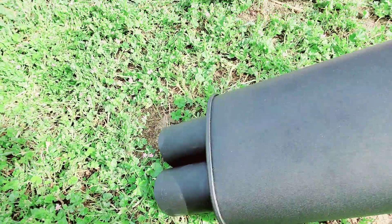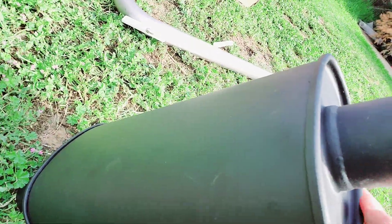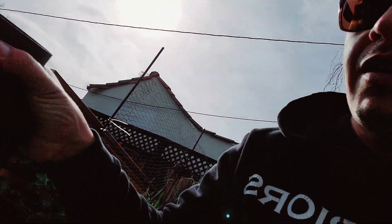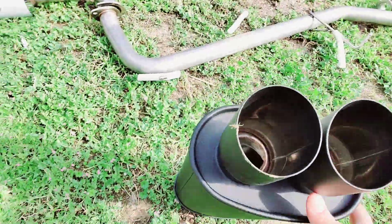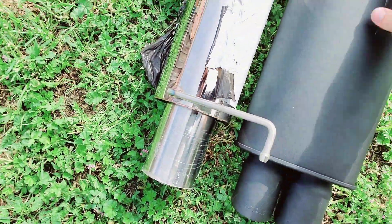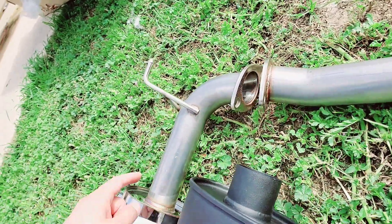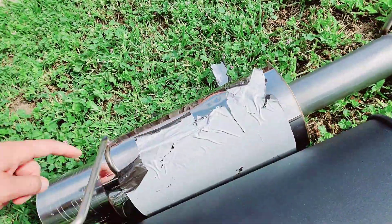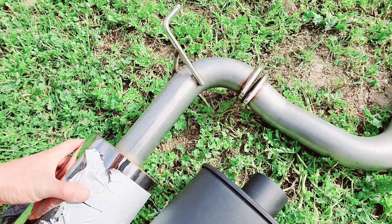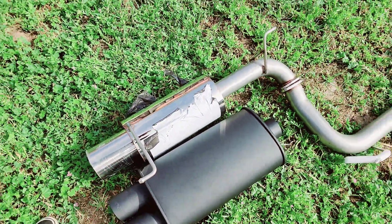The Vibrant muffler is very good quality — appears to be painted or maybe powder coated. It's pretty heavy, so I know there's a lot of substrate in there. It's going to look very stealthy on the exhaust system. The only issue is this muffler has a two and a half inch inner diameter inlet and the pipe is two and a quarter, so I'll need a small adapter. I'll cut the pipe and have someone spot weld the adapter wherever it needs to be.